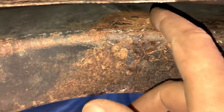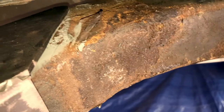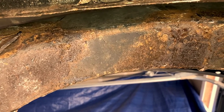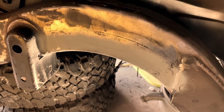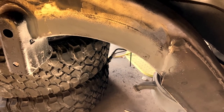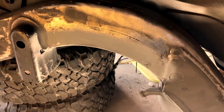That's all cut up. I got to sand this down a little bit. I still need to weld this — I got to clamp it down and weld that, but I knew I was taking the axle out so I couldn't get back here and do it the right way; I figured I'll do it now. Not too bad at all — it wasn't as bad as I thought cutting all of it out. I etched it with a weldable primer and undercoated it already. I did not cut the ears off. It was pretty rusted so it all came off pretty easily. I already welded the other side, so that's done. Now I'm going to place the bracket, put that on, and show you how I measured it — it came out to 18 and a half inches, and I even squared it for a test fit already.